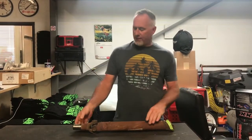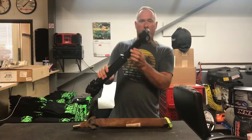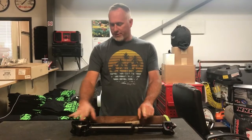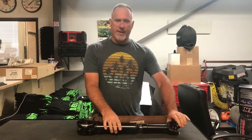That's no good with long travel — it's going to slip right out. If you keep this style, you have that potential of slipping right out of the transfer case, which we don't want. So we move to this style where plunging actually happens on the driveshaft, and then you get a solid yoke attachment at the back of the transfer case as well as at the rear diff.